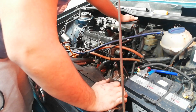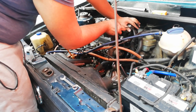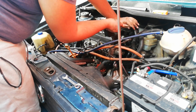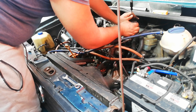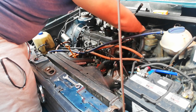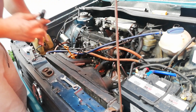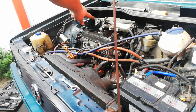There's also a vacuum pipe that needs to come off here. And then you have the MAP sensor as well — just unplug it, it's that simple. Then I'm just going to get the throttle cable which is on the throttle body over there.